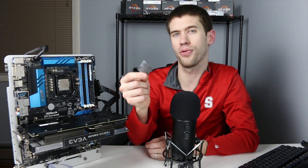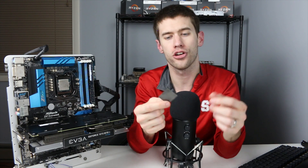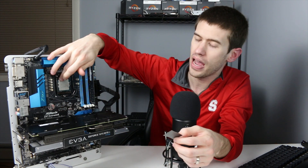The second homebrew method that I actually prefer is licking the pad, exactly like an old-fashioned stamp that doesn't have any self-adhesion. The reason for that is you're still anchoring the graphite pad down to the CPU without any extra material — no risk of a little bit of thermal paste spreading out and getting down into the socket. All you have to do is give it a lick and stick it on the CPU. You will want to straighten it out when you put it on there, and with that you have a graphite pad that's not moving around while your CPU cooler is being mounted. And because it's just a graphite pad — it's a mineral — it does not hurt you. It's non-toxic.